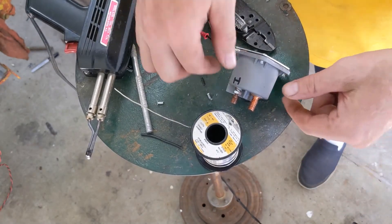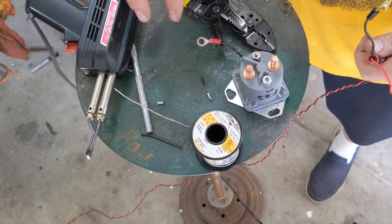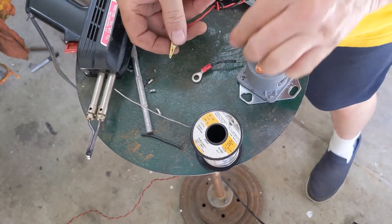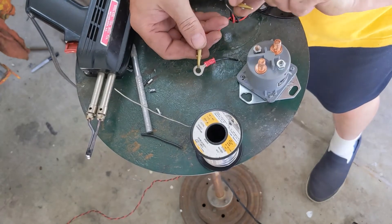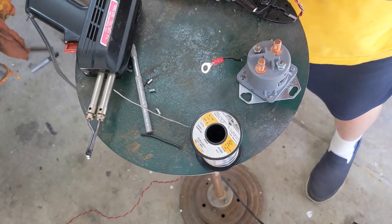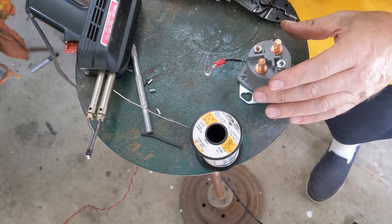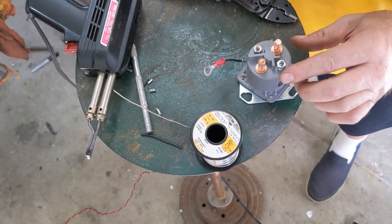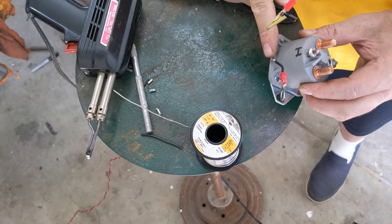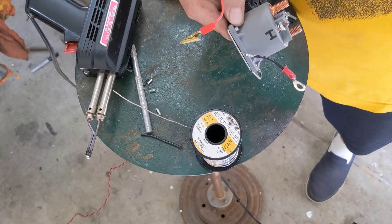Next I can test the result. This is the start terminal and this is the ground — I'm going to be using positive ground. Let's see if this works now. Yep, beautiful — so now it'll work in either direction because it's just a DC coil. All I need to do now is hook a diode externally to absorb the reverse voltage that's generated. I'm also going to epoxy this connection since it's kind of fragile sticking out the side. Should be good to go — see you in the next video.